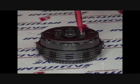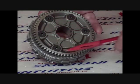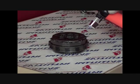Next, in order to get the clutch apart, you will need to remove the 6 screws either from the pressure plate side or the gear side. We prefer to get the screws off from the pressure plate side to keep the ball cage upright. You're mostly going to find that the screws are difficult to remove. They have Loctite on them, so applying heat to the screw head will crystallize the Loctite and make removal much easier. Heat the screw head to 600 degrees Fahrenheit and allow a cool down period before removal.